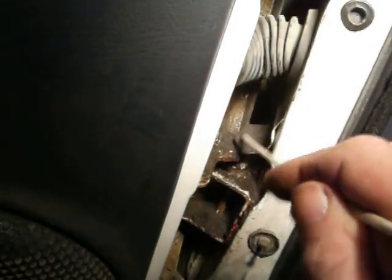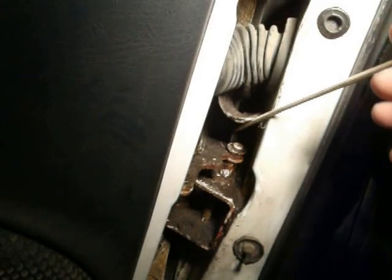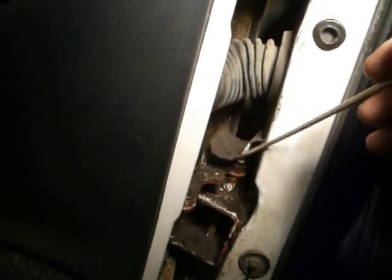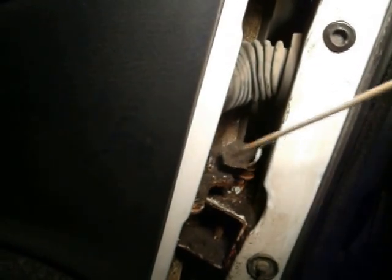The other thing I did is these little rollers. I did this a long time ago. These little rollers that stop the door from banging open get soaked. Up here in Canada, they get soaked with ice and snow and water. I put a little flap of plastic on there so the water runs down here, and instead of dripping on the little roller, it just drips off to the side. So my little roller doesn't have any flat spots on it. It still works. As soon as you hear it get noisy at all, just drip a little more oil on it. Anyways, I can't think of anything else.